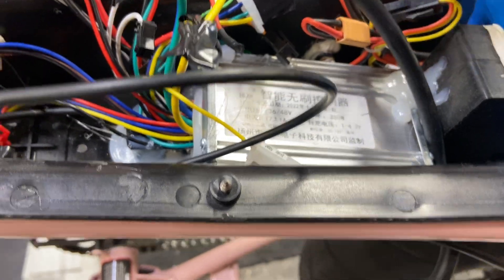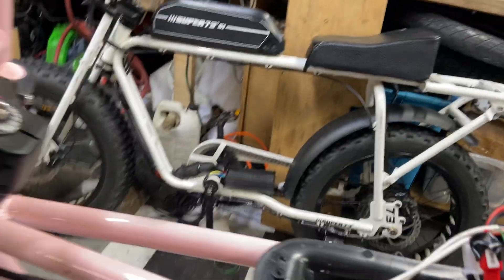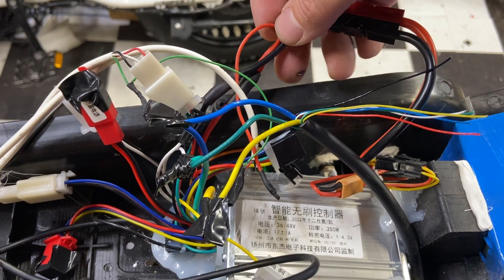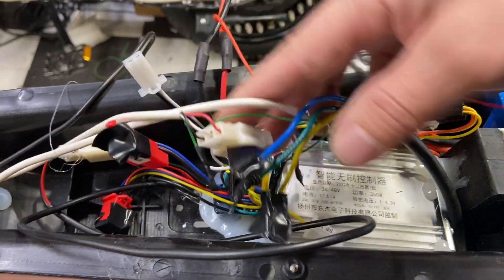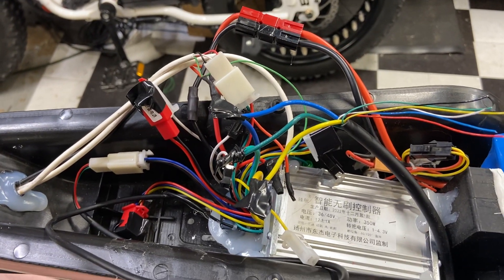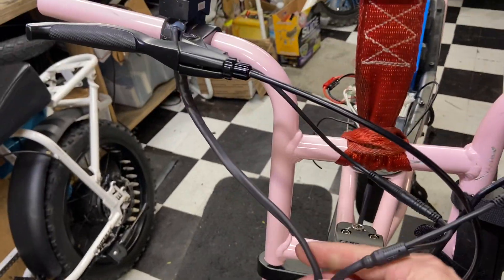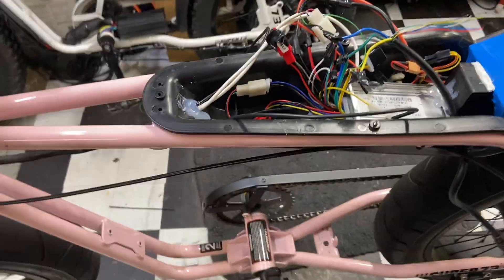I don't use the hall sensor wires — I use a stock connector right here. I chopped everything up inside here. This controller has a three-speed switch, which works amazing — I call it the secret turbo switch. I just put it underneath the seat because I ran out of space on the handlebars. I had to take B+ to power the switch that goes to the brown wire. The controller itself has a switch wire that went to the red wire, and also to the green wire for the display. The throttle is a six-wire — you can use five wires if you just tie the red and the green together. It's got the e-brakes wired in, and everything comes down right up underneath. I'll put the seat cover on tomorrow.